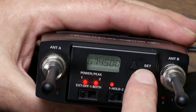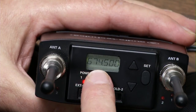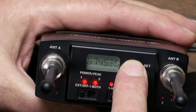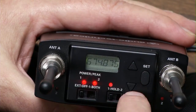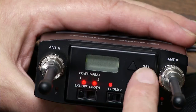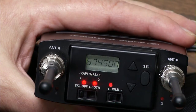Let's do two things. Hit the menu. Let's say someone said they want you to be on a particular frequency. Hold the set button down — they've given you the numbers and you can go up or down in big increments holding this down, or little tiny increments. When you get to the frequency you've been told to go to, hold the set button and keep holding it until 'stored' appears. That's real simple.